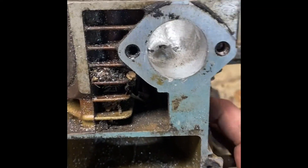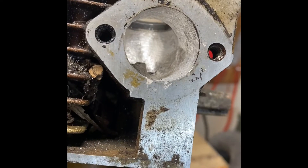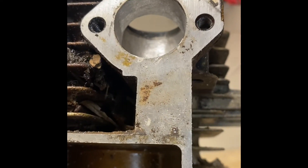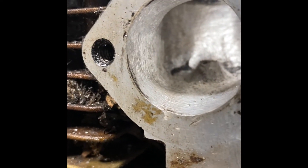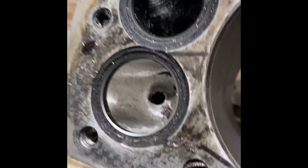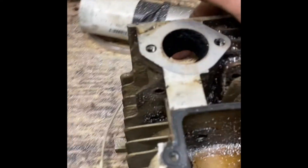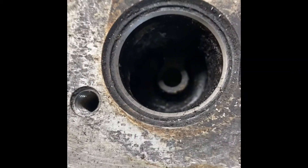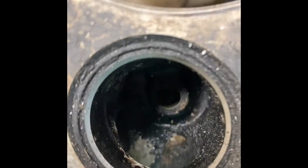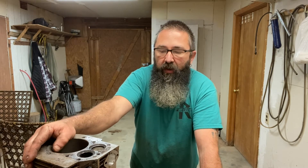I'm going to run the round port. And there you have it — final product. Guide's narrowed up nice. Got a nice round short turn. The fuel and air no longer have to go around a corner; it's a nice straight shot in. Everything nice and smooth — you can almost see the air going through it. And just for the heck of it, there's your stock intake port. Yucky. We certainly got into the nitty gritty today. I hope you all learned something — I can't wait to see and hear results of you guys trying this on your own.